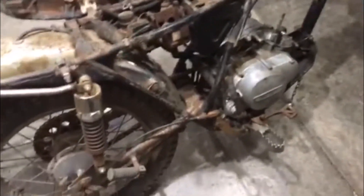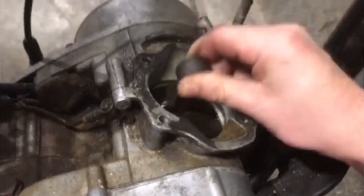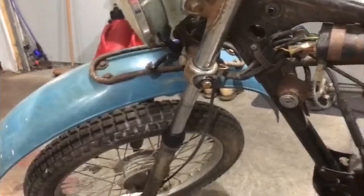It's a low-hour motor — I can tell because everything is normal here, there's no play and just a little bit of side-to-side like normal, and it rolls over nice and smooth. The tank is not bad, no major dents — there is one little one on the other side but nothing major. You can tell she spent some hours on the trail from the leg wear taking the paint off, but she's still pretty clean. The slide wasn't seized up, which was surprisingly cool.